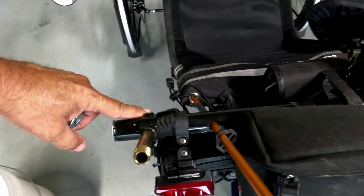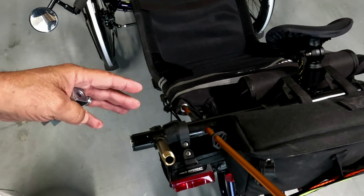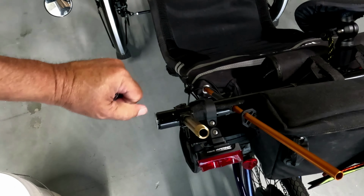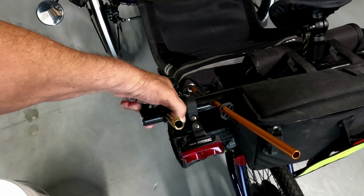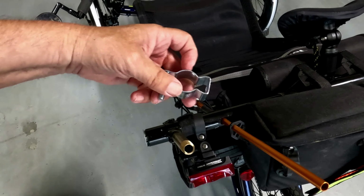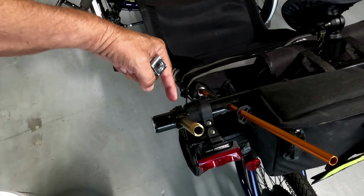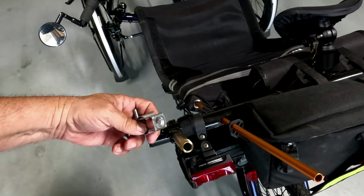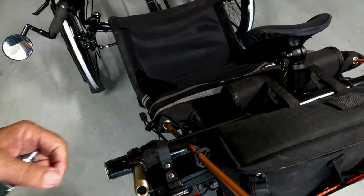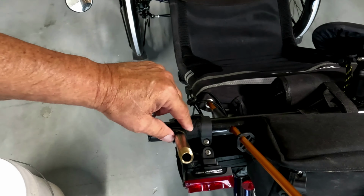The trike is only this wide. The top's got to fit out here. In fact, that's how you adjust this before you drill it. You build the whole thing like I've showed you, but you leave these for last. You go ahead and put your top in this, and then you spread it to where it's taut, as tight as you can get it. Some way clamp it off, have a buddy hold it, whatever. You've already pre-drilled this out right through the center right here, going right through it. And you mark this PVC when you drill this, you mark it, and then you go ahead and drill your PVC and then run your bolt through it. That way when you put your top on, it's tight from side to side. And that's how you achieve your tautness. So do this last, both sides, after you put your top together, build it, cut it down.